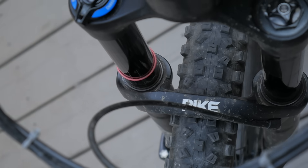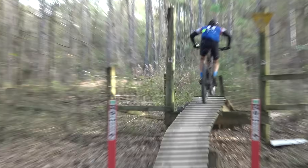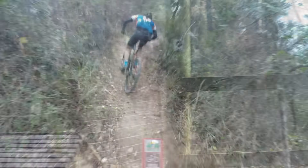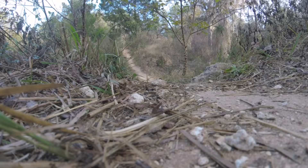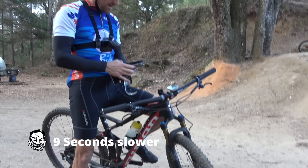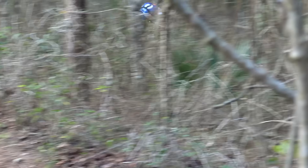Now that we have a basic understanding of the settings on your fork, let's have some fun. Meet Clint Gibbs, a fellow YouTuber who races XC and cyclocross. Today he clocked a time of 2 minutes and 58 seconds on this course at Santos. We maxed out his compression — cranking it all the way up, which makes the fork all but locked out. When sprinting and climbing this would have been a benefit, but this course gets pretty chunky in some sections. It was harder for Clint to maintain control in the rough sections and transfer power to the ground efficiently. In the end, he fell short of his fastest time by a full 9 seconds — a lot for such a short course, which shows how much of an advantage suspension really provides.